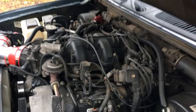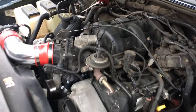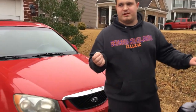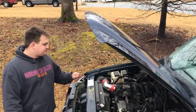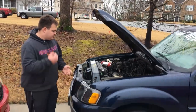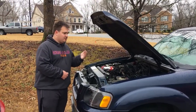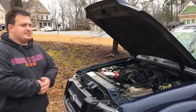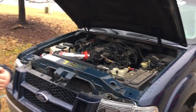These spark plugs have probably never been replaced. It's had a rough idle since I got the truck. I believe it's more than likely a combination of my fuel filter being clogged — we were just underneath the truck and it was disgusting — as well as the spark plugs needing to be replaced. I'd recommend checking your maintenance and making sure everything is good. I'd recommend getting fluids done and all that stuff before you put a tune on, because you don't want it on a pretty banged-up engine. It's not required, but it's stuff I'd recommend doing just to make sure your tunes are perfect.